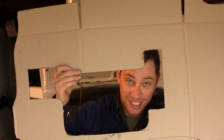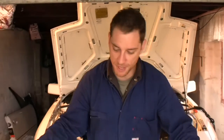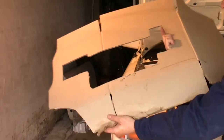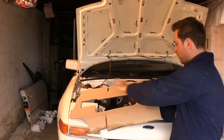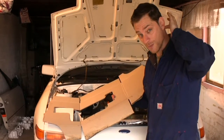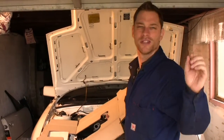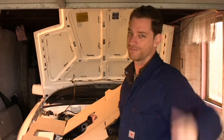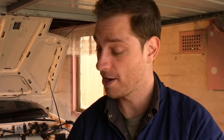This bit of cardboard is going to be the shape of my bit of metal in the engine bay. It's going to have a little bend so when the air goes in it scoops it up and keeps the components nice and cool. I've seen people say their motor controller gets too hot and they make water piping underneath it. I don't want to do that, so I'm going to make it out of aluminium for two reasons. One, it'll act as a big heat sink for the bits that get hot.